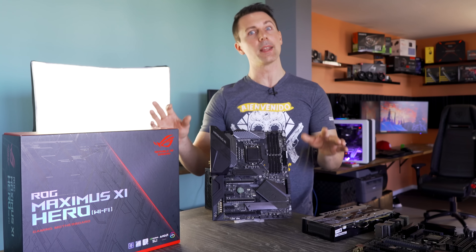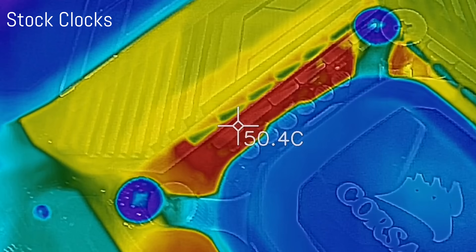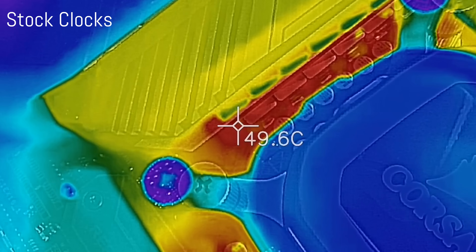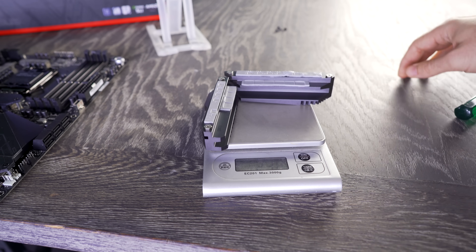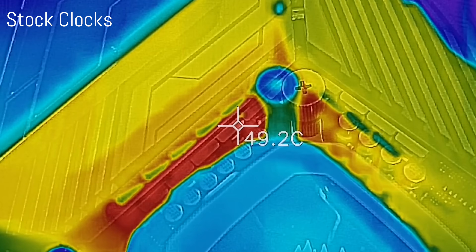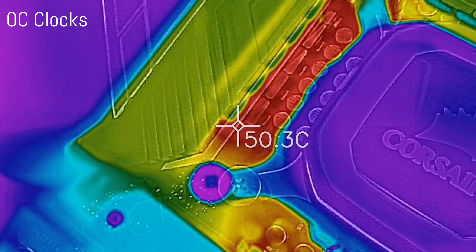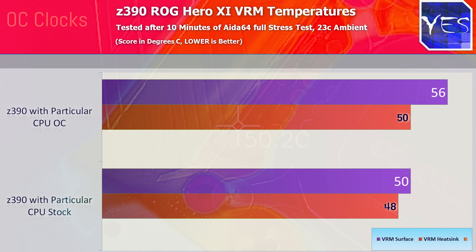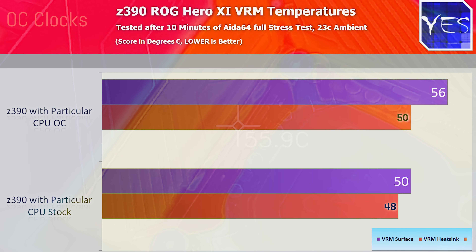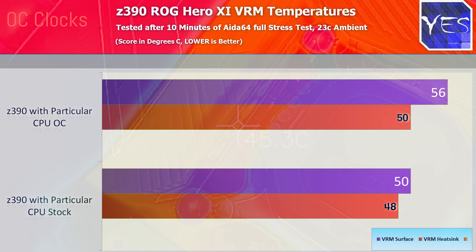Now let's get back to the overclocking. I can only talk about a CPU that put out a lot of heat at this point. This motherboard's VRM and heatsink — the heatsink weighs about 300 grams — when viewed with the thermal imaging camera during an overclock, the VRM was running around 50 degrees out of the box, and manually it only reached around 56 degrees. This was phenomenal performance from ASUS, with very good power efficiency compared to other boards. They've definitely got things right in terms of the hardware implementation on this board.